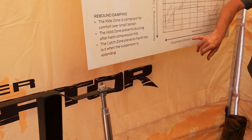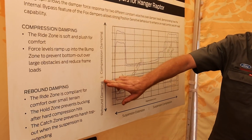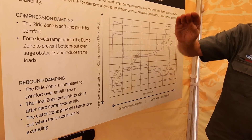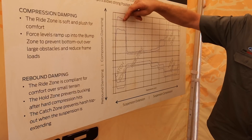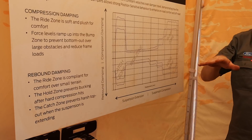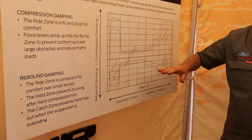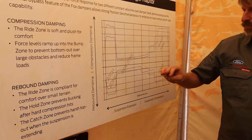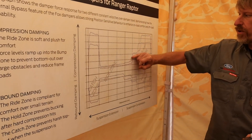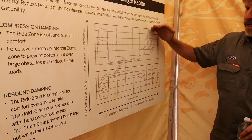What we have here is suspension travel and this is damper force. For a fixed damper speed, you start at the top with a very high damper level, and then that drops down to this area — which is your typical around-about curb to up-ride condition on the road. So it's very low down-forces, which allow this magic carpet ride. As you go further into compression you start to close off those orifices and build up the damper force.